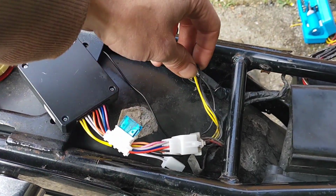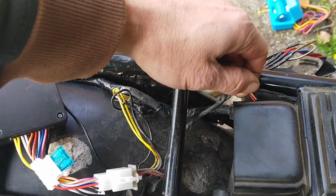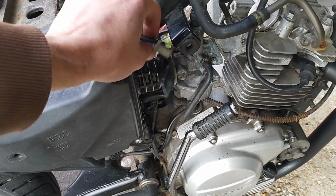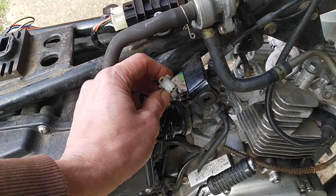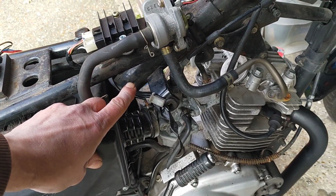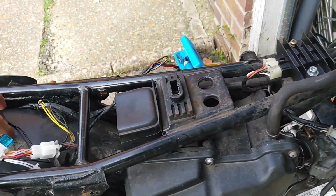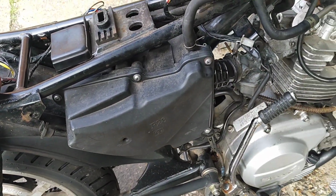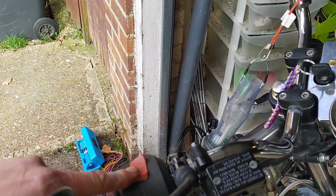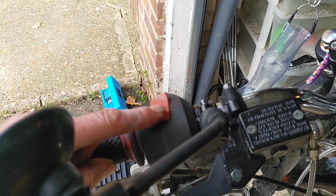Looking at the wiring diagrams again, I think the principal one that does the electric ignition comes out here, with nothing attached to it. Now, frankly, it doesn't really bother me, because what I can do is just have it as an alarm rather than as an ignition unit. So I could just leave it like that and the job would be good. But that is probably what I will end up doing. But the bit that concerns me is how this is wired the wrong way around. I chase the wiring diagrams around, and it is just a straight on-off switch.